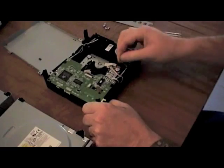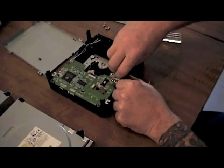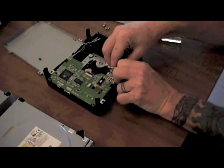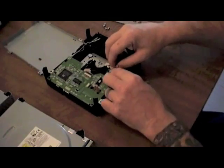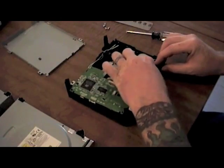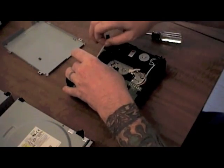There's a little piece of epoxy that holds the cables in place right there. You can choose to mimic that when you reassemble it. I found that electrical tape is not a good substitute. My suggestion is medical tape — like for bandages, the little white fabric-style tape. It has a good adhesive nature to it, it will stay in place, and it's probably the best option.